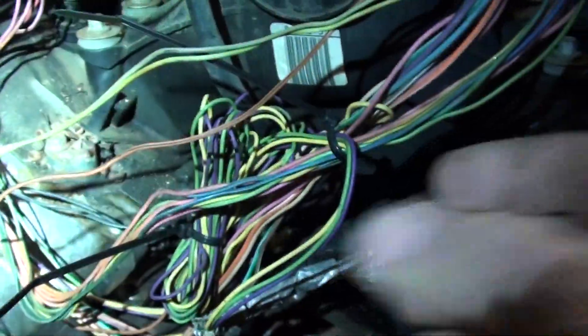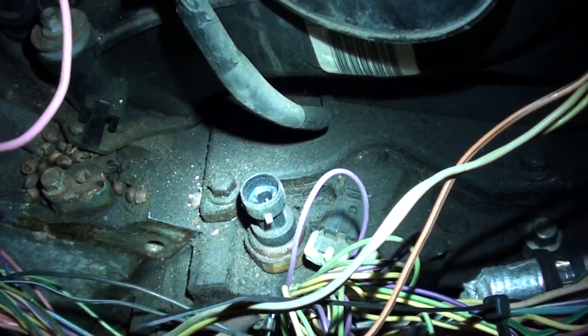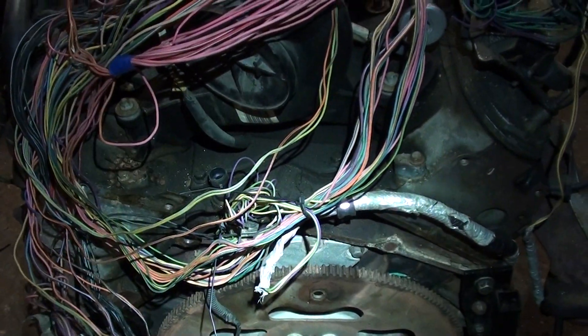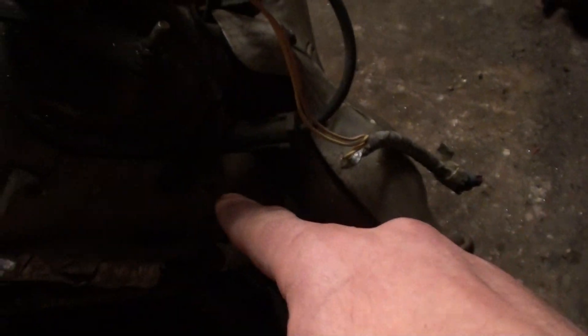The harness lead I'm going to shorten by about three feet. Then you've got your cam sensor wire leads and your oil pressure sensor, which is optional in the harness — I removed it but I'm going to put it back in. I'm going to move the coolant temperature sensor lead to the back corner on the passenger side cylinder head to get it away from the front.